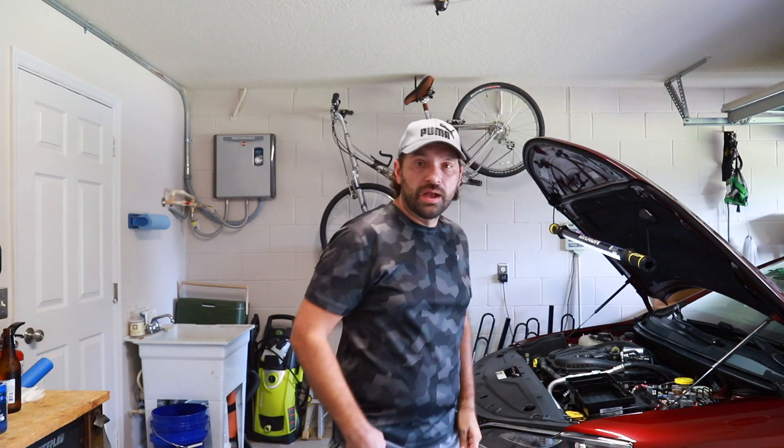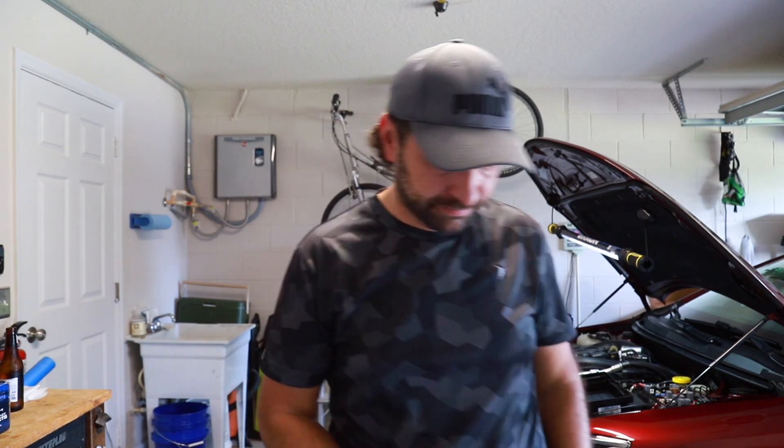If you haven't seen my lower intake manifold video, I'll link it in the description — go take a look at it. It shows the complete disassembly of the upper intake and where the fuel rail is. You don't have to do the lower intake at this point, but last time we had a disaster with fuel leaking all over the place and everything stank like gasoline for a whole day. To prevent that this time, we're going to relieve the fuel pressure. The easiest way is to start the car and pull the fuel pump fuse — that way the pump won't push any more gas up there and the car will just die.